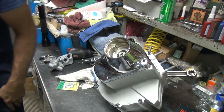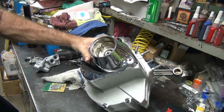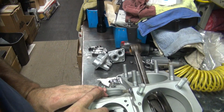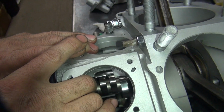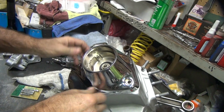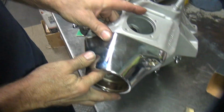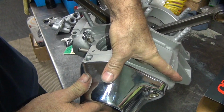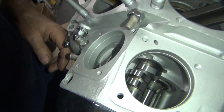It didn't quite go on like it's supposed to. Looks good. Now it's down all the way through. I have to admit, I didn't expect that. That is end play. It appears to have adequate end play. End play is good. So you can take 5 out or you can leave it. No, it's good. I'm good with it. So I don't need to put the screws in there because they're already in there. Right. Now the cam's sliding back and forth, which means it's not too tight on the shaft and the alignment's good. So you can put your finger in there, you should be able to rotate it, but in this case I can't. So the breather is sticking or something.